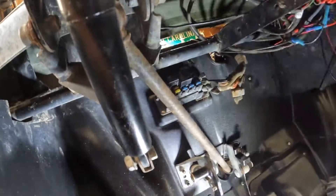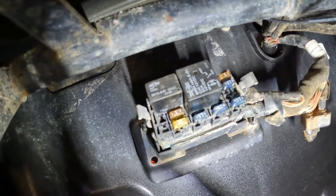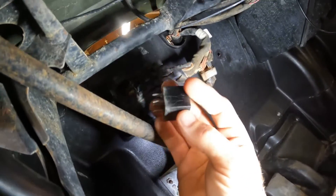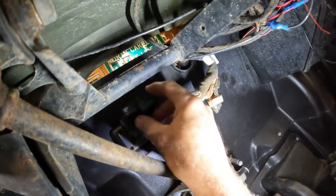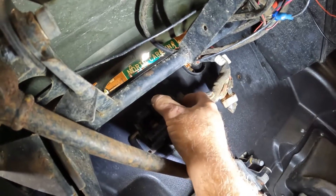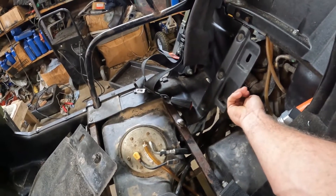This thing has to have a relay, so I got to checking the relays. I noticed that when I switch it on, the relay on the left side clicks and you can feel it click. But this other relay here was not clicking. I unplugged it, looked at it, everything looked fine. When I went to plug it back in, it just kind of slipped in — it didn't feel right. So I thought, maybe this thing's backwards, and I flipped it over. It took a little more force to push it in properly with it turned the other way.